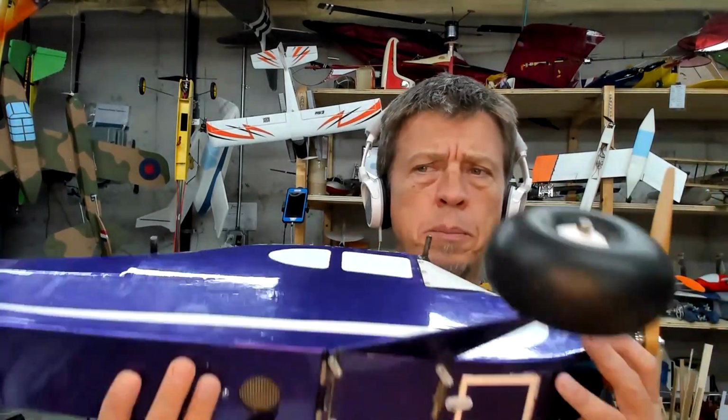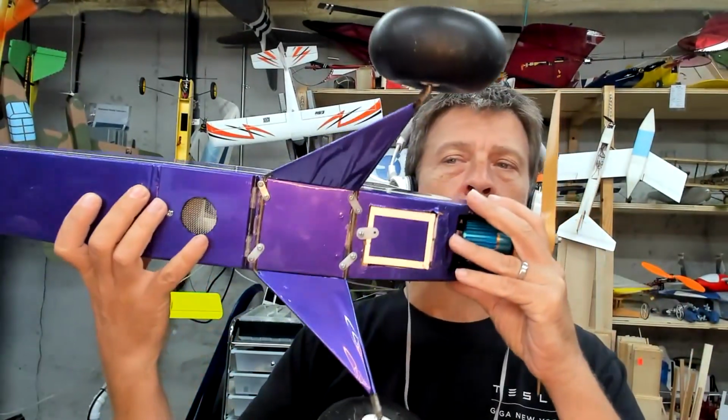It could be. Maybe it's because it's on these big bouncy wheels, or could you have the right wheel lagging or something, causing it to want to pull right? They both, I'm going to check that right now. No, they both roll pretty freely. It could be something other than the thrust angle. I don't know, but could the gear have a different angle? Could you have a cattywampus axle? I know that they're not straight, but also I wonder with these big balloony tires how much that matters.